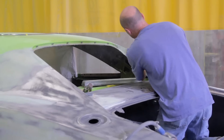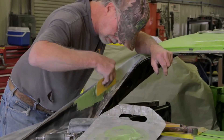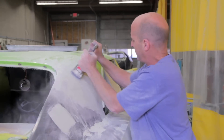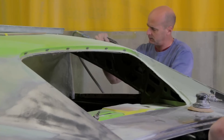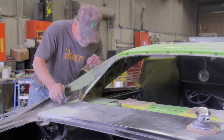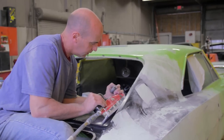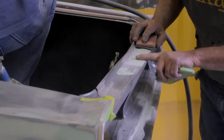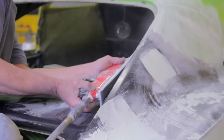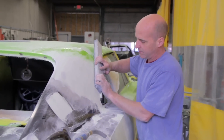The collision job on the Charger is moving along. Once the sheet metal is on and welded up in the factory places, it's time to do the cosmetic work — plastic filler over all the panels. Make sure they're square, straight, with good gaps. Then you're ready to primer them, get the primer blocked, re-primed, re-blocked, and ready for the sublime green paint. One thing I'll stray from the OEM appearance is the finish — an original manufactured car was done in single stage enamel, real orange-peely, with runs and transparent spots. But most of my clients have preferred a better paint finish than what it would have been OEM. I'm pretty fortunate — I've got good body men, good painters, good assembly guys. I can turn a department loose and know that when it comes out, it's square, straight, and flat.